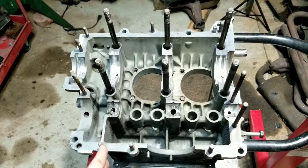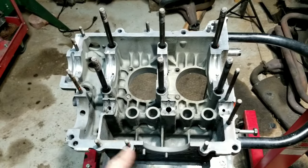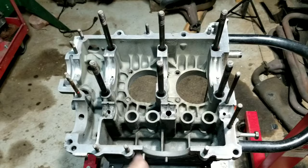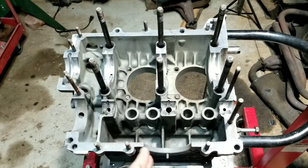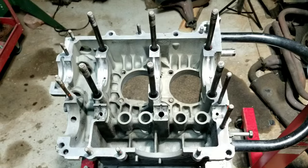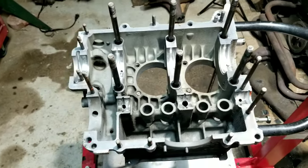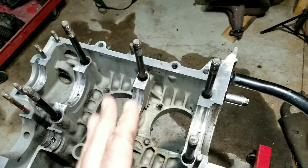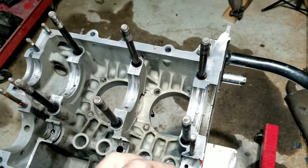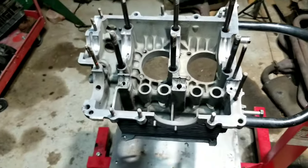It's kind of a versatile cam. It's between an Engle 100 and a 110. We were measuring stuff and figured out a couple things on that. We're not going to get into that right now, but it's kind of between those two, and it's got a different grind. It's less lift and more duration than the 100 or the 110. So it's kind of a different ratio in there, but it actually works really well on a lot of different applications.